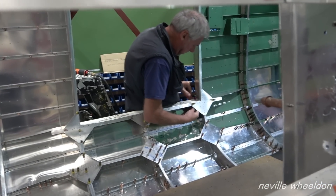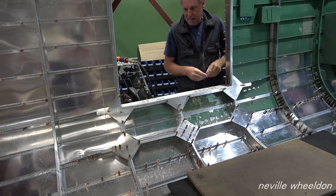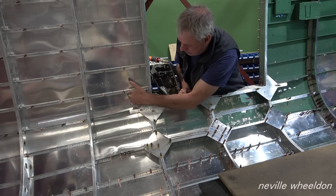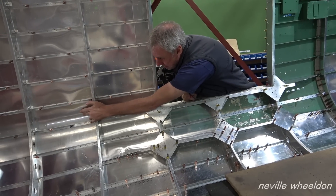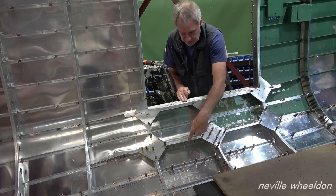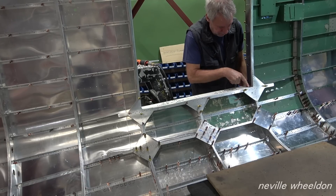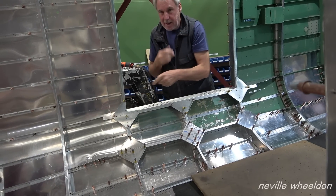You've put a lot of work into this door frame, Phil. Yeah, there's a huge amount of work — we've done the big bits, which is former 32 and former 30. The reinforcing skin here is about 16 gauge, then there's another reinforcing skin, then the outer skin — three pieces of skin there — plus all brand new frames at the top and the bottom. Now we're doing all the ancillaries, which are all the little cleats that attach that to the former. There's cleats everywhere.